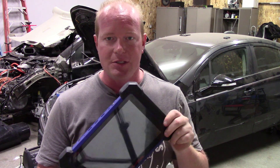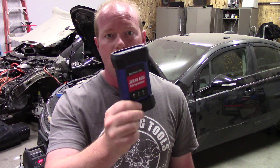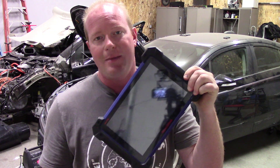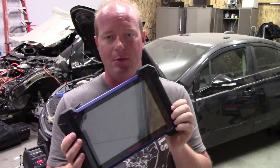This tool has the same diagnostic capability as the MS908 and MS908S, but it also has all the key programming features. It also comes with a J2534 box. One of the reasons this tool solves my problems is that all the airbags blew in this car, so I have to reprogram the airbag module — you can't reset it on this model. I had to go to the dealer and buy a brand new airbag module and program it to the vehicle. So now I can program my keys, do all my diagnostics and code reading, and I have a J-Box to program via the OE website. It's a perfect tool.